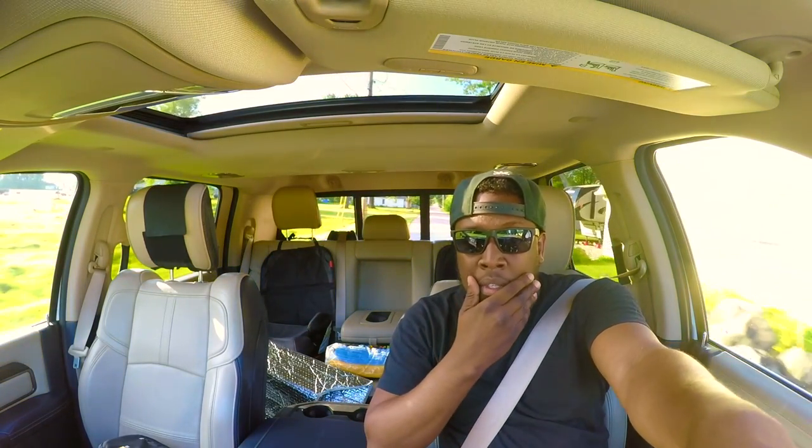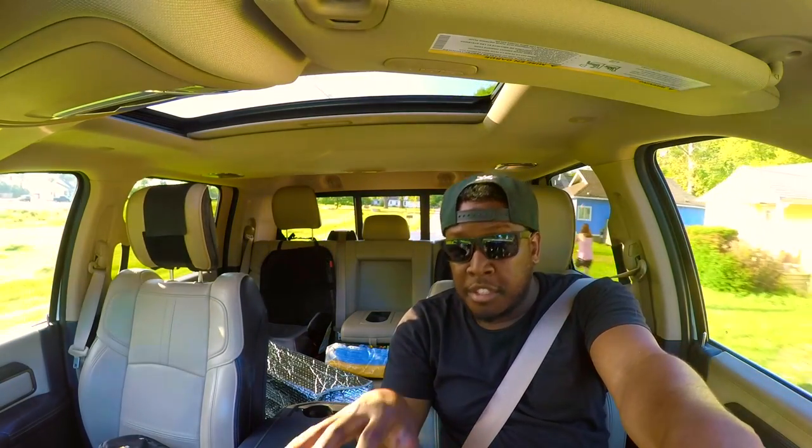If you are looking at tires for an HD, do not sleep on 35-inch tires. As I've said in past videos, I have the 295/65s, so I actually have more height than an actual 35 by 12.5 or 35 by 11.5 inch tire. I'm glad I went this route because I didn't want too much width this time around, since we're traveling with our fifth wheel and our goal is to go out west — I didn't want to affect my fuel economy too much.